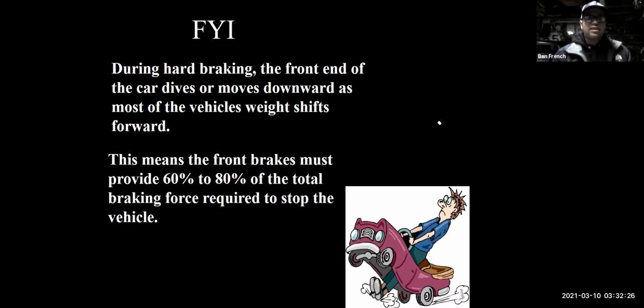All right. Well, I won't keep you guys in suspense, because you're probably sleeping anyways. What it is, your hybrids and your electric vehicles. So you take a car like a Prius, and what was weird about those is if the person who drove it was a really good, smooth driver, and so they weren't slamming on the brakes, they were stopping gently, that car would do a lot of regenerative braking. So what brakes on that car do the regen? The front wheels do the regen.